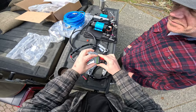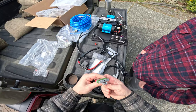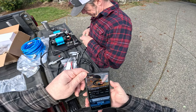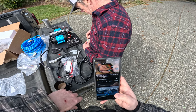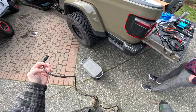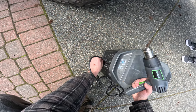We pull out the clip — it's just a soft rubber clip, easy to remove. Following the instructions for which color wires go where. Now we have to install the supplied ring terminals using wire strippers or a sharp knife, then connect the harness.